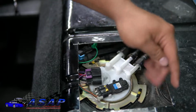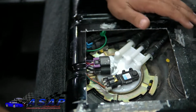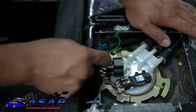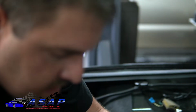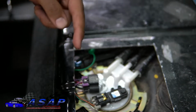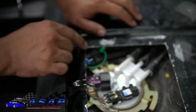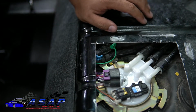So once you cut the top, cut the side, then come over here and start pulling this up a bit. What you want to do is find something like, I guess the best example would be, you go to Lowe's or Home Depot and get some door shims, the packet of shims for shimming up an interior or exterior door, and try to shove one underneath here to separate that harness from there. Because the last thing you want to do is run down with your Ziz wheel and cut into your harness, and you get a really bad day. That way, if you do accidentally get through a little bit, you're just cutting into the wood and you start seeing that you've gone through.